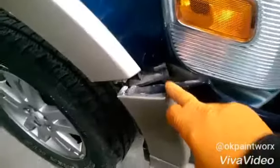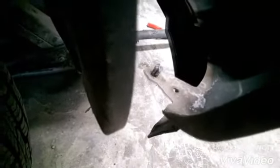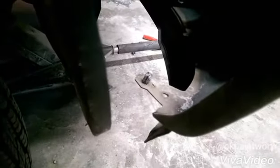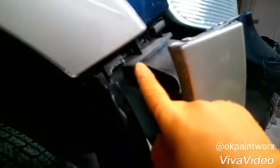The only other thing is this edge of the bumper snaps above here, so that just snaps out. But before you remove that, there are two holes at the bottom, and that one clip at the end of the bumper — it's kind of hard to point to — is just attached to this inner fender at the bottom. You just pull that clip out; a lot of times they break. That is the only thing that holds it on the end, along with this retainer bracket.